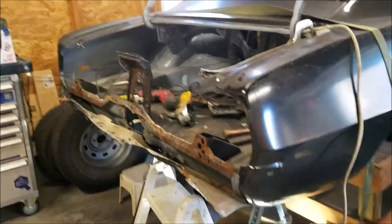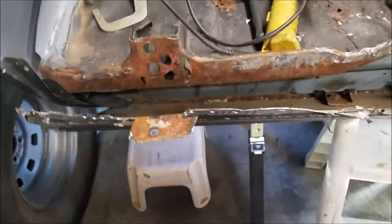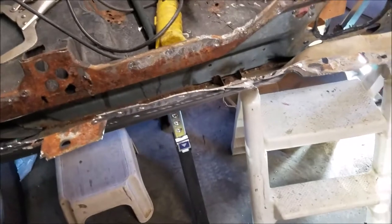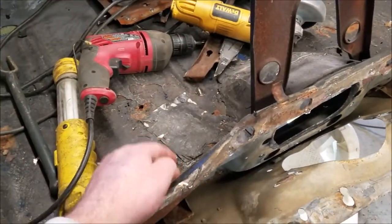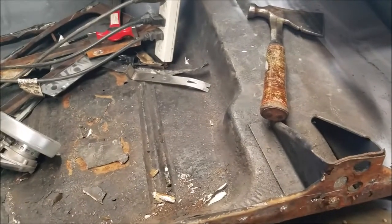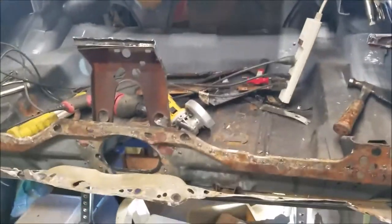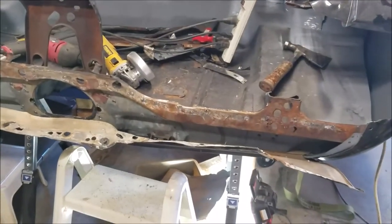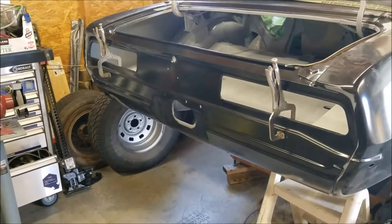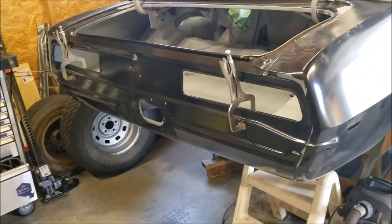Alright, I'm done for today. I got the bottom edge of the tail panel removed — all the spot welds pulled off. This thing looks like crap, but it looks like it just welds on top of the floor pan of the trunk, so I've got to do some research. I might change that out — I'll see how it goes. Garage log 2017-04-04, April 4th, 2017. This is the first test fit of the tail panel on the trunk.